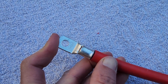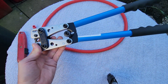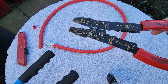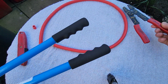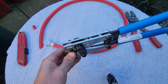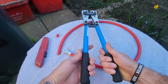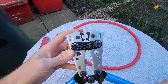Pop the terminal on right there — nice solid fit, look at that. If you've never used one of these before, it's pretty much a glorified version of a standard crimper, but it works with thicker wire. This smaller one only goes up to AWG 10, whereas this one actually goes all the way up to AWG 0 or 1/0 — in metric that's around 50 millimeters squared.